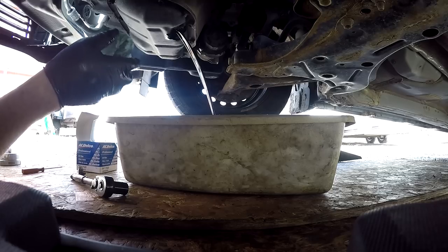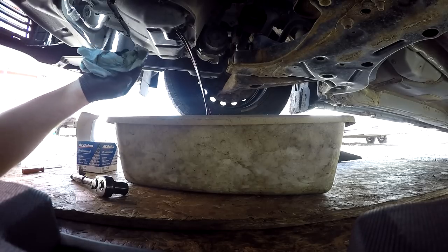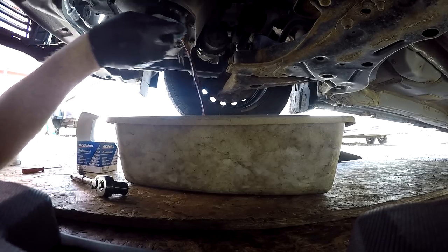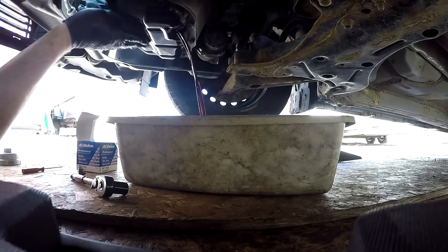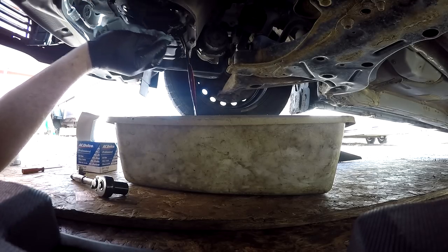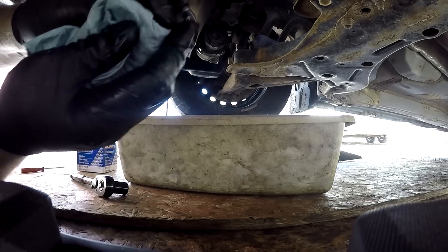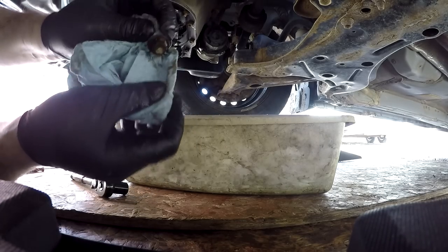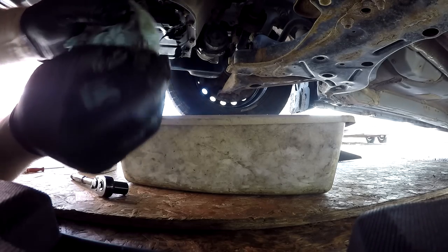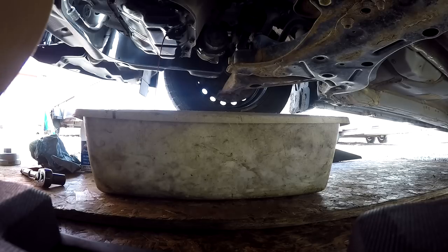I was going like 8,000 kilometers between changes and this one has only got about 4,100 kilometers on it now, so I'm gonna change it and see how the next one looks after that. I'll clean this up a little bit and rub a bit of oil on it too to keep it from rusting. This one's not as big of an oil hole as the Ford truck, which I've also got to do soon. The Ford truck has a big plug — pull that out and man, it drains fast. It's got like 13 liters too.